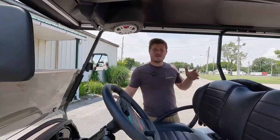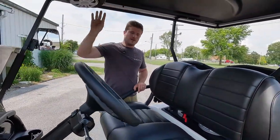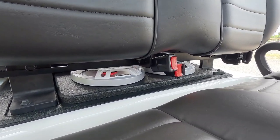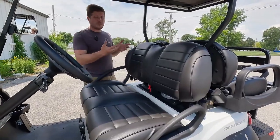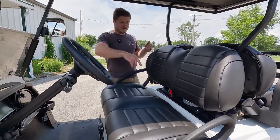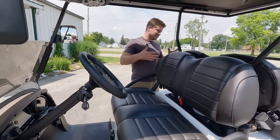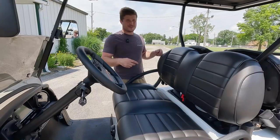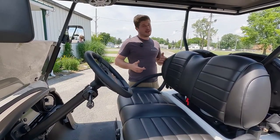We have two speakers up front in the Club Car overhead console that we retrofit. We also have a waterproof speaker enclosure in the back with Hertz HMX 8-inch speakers. That's a sealed box — it's not open from the back end, so it's not an open environment. The speakers actually sound good versus just drilling a hole in the body and throwing speakers in there.